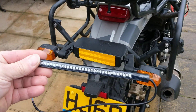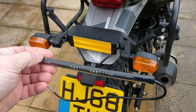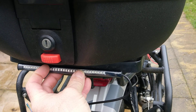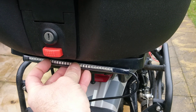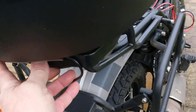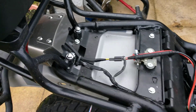Next thing to fit is a little bit of additional lighting. You can get these strips - they're about five or six quid. I've fitted many of these to many of my bikes and other people's bikes. That's going to stick on there - they stick really well. The center piece is all red for tail light and brake light, so dim and bright, and the outside pieces are indicators so they'll flash in unison whenever you indicate left or right. I can lose the wiring quite nicely up under the mounting bracket and tie it into the back there.